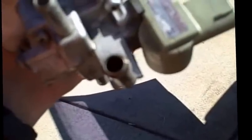So keep in mind that this tube right here, use some throttle body cleaner, scrub and clean the inside of that with a toothbrush. And what I did is I just capped off the hose at the bottom, filled it with throttle body cleaner, let it sit for about 20 minutes, all right? Let it flow out. This thing was so clogged up, I could not blow through it. It was more clogged up than an old man that needed prunes or something like that.